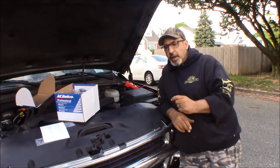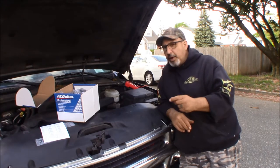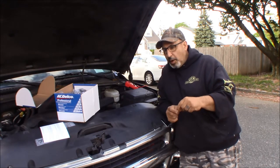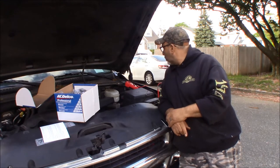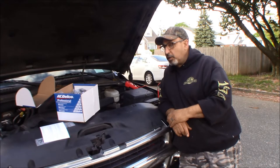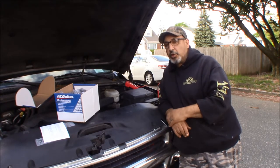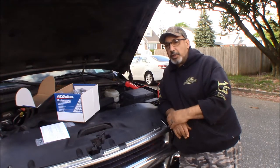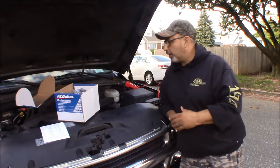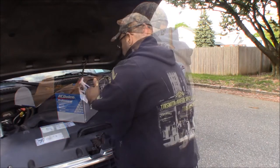And sure enough, when I connected the charger this time, it really sparked well. So I'm wondering if, with the alligator clamps, maybe I pinched the rubber instead of getting it on the side terminal nub there, because it looks like it's charging and the voltage is going up relatively fast. So I think it was operator error, meaning me not having the charger on all the way and letting it sit for 26 hours with the charger not actually charging the battery. So now we'll take a look at the alternator. Hopefully the one in the box is the same as the one on the car.